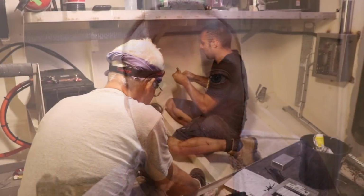It's a steel adapter, it's a steel bung, so we'll be able to drill and tap into steel, so we should be able to get a nice beautiful thread. We're not going to get that out of the cast iron unless we do something dramatic, and then either way we've still got to go and put another bit of steel back in. So our plan at this stage is actually to modify that bung and use it as our adapter.